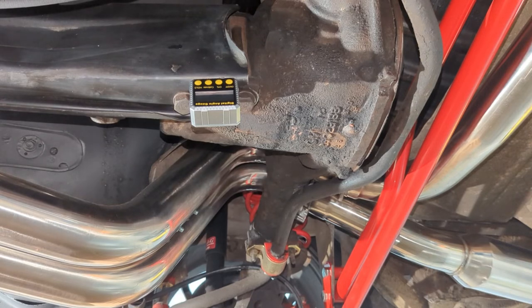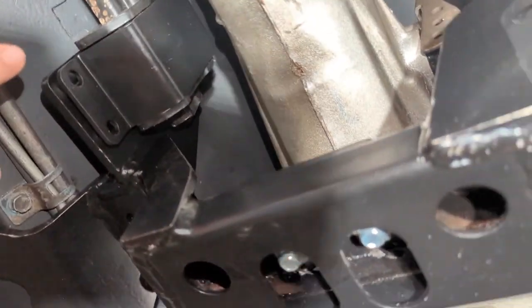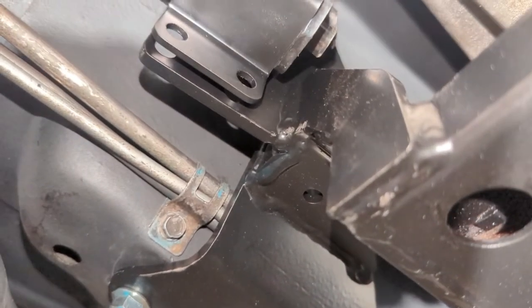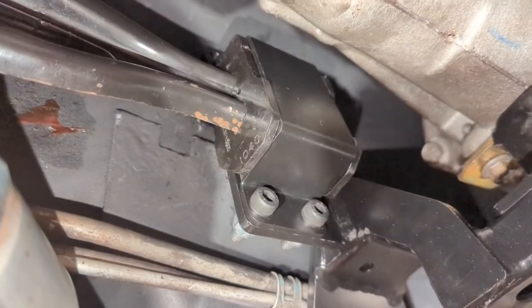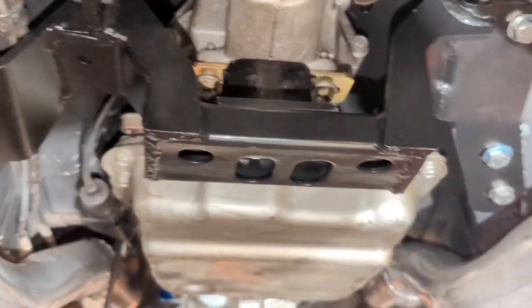I wanted to make sure we were as close as we could be. The rear torque arm itself has some adjustability — there's only where the bolts go through. It's slotted at the bottom, and I think there are three sets of holes at the top. We're in the bottom hole, so we can't go down any further. I'm just going to go ahead and lock it down — I just wanted to see what set of holes was the best. The bottom, for us in this situation, is the best. I went ahead and rechecked the rear end and it checks at 0.3 now, so that puts us at 3.3 negative. That should be just fine — not that we can do anything else about it anyway.